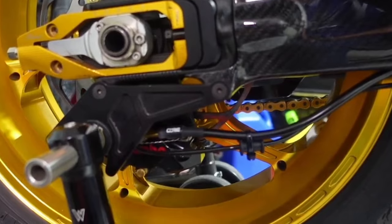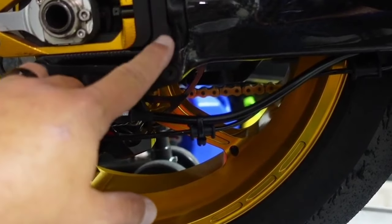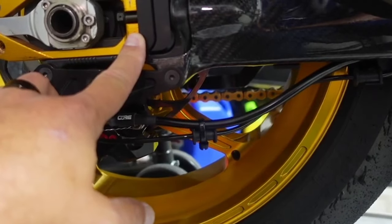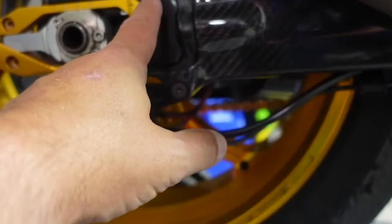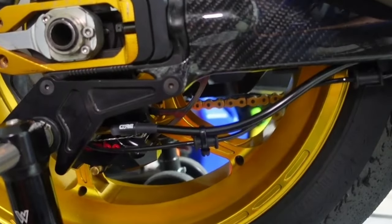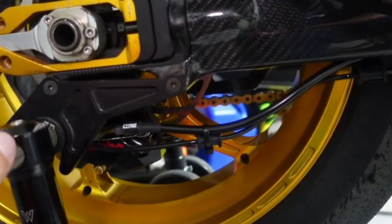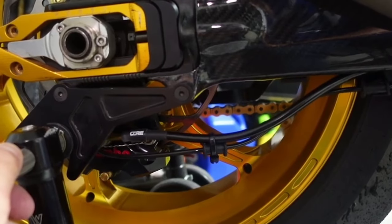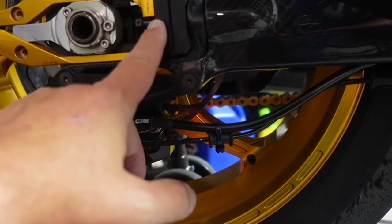When you're able to get the axle further back — in this case almost an inch — you get more grip. There is some diminishing returns if you make the swing arm too long, but even going all the way back it's not going to be too long compared to the Suter swing arm and other choices. I took the swing arm, had it milled — covered that in the last video — and there are two spacers here from Fast Frank. Fast Frank sold his company to i1 Moto, so Fred Bally of i1 Moto now owns Fast Frank.